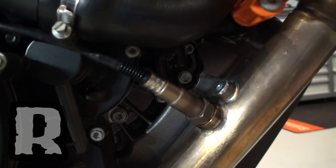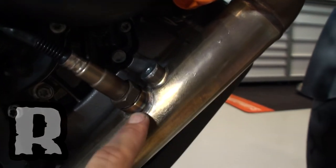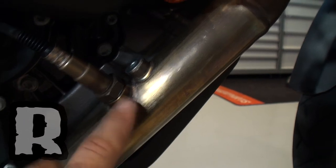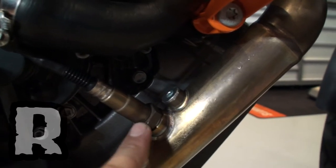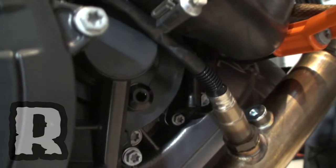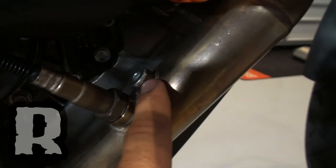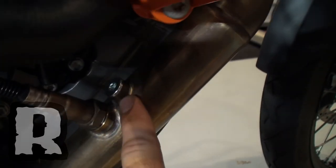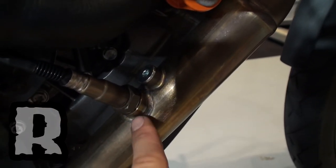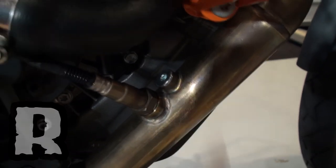On the front, the wideband O2s are a little longer than the stock ones, so you don't want to cut these off — you're going to want to run your new O2 bungs. We have these nice stainless ones, whereas mild steel ones come with the auto-tune kit. We put this at a slightly different angle so it comes up right underneath the water line. This allows you to go back and forth between stock — we've capped the stock bungs off using 12mm O2 bung caps, and we also have caps for the 18mm x 1.5 O2 bungs. You can swap them out if you ever decide to remove the auto-tune.